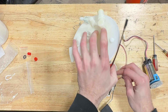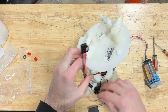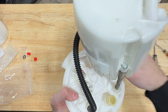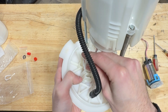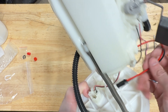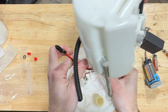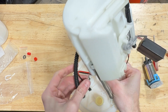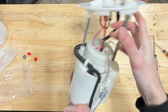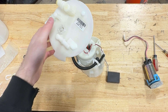From there, we're just going to reroute our wires. We had our secondary clip here. These top hat connectors only fit where they belong, so you can't plug them in the wrong spot. We're going to take our new fuel pump wiring, anchor it in the top like the factory one was, and then plug it in. And we are all done. That is the new fuel pump installed in the basket — we're good to go. You can go ahead and reinstall this back into your car the same way you pulled it out.